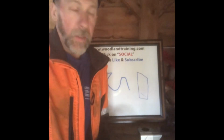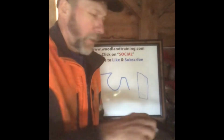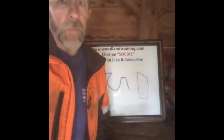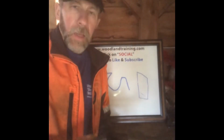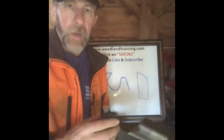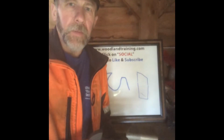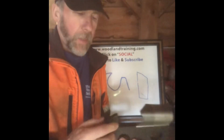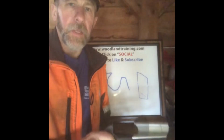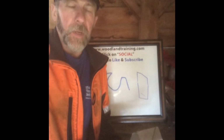Let's really quick review what that depth gauge does. All right, this guy up in the front. Depth gauge, raker, drag, rider, whatever you want to call it. Basically, we talk about it setting the thickness of the chip. Fair enough. But let's define what it does from a different angle. Let's talk about how the thickness of the chip, or the setting of this depth gauge, affects what we call the reactive forces off of the saw.